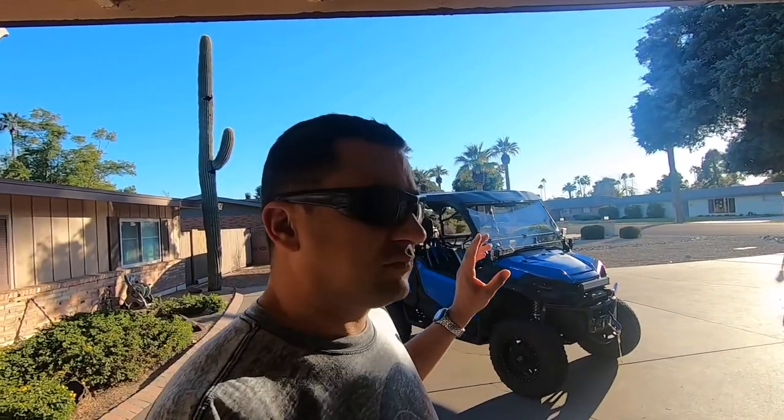So tires are awesome. What I did the first time I ran the dunes, when I just ran the stock rims and tires, is I turned it down to like 4 or 6 PSI. I really widened the stance. The stock Bighorns are a pretty good tire for the dunes, believe it or not. But these truck tires just stink. So get you some good tires.